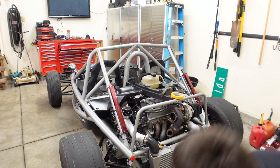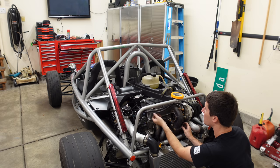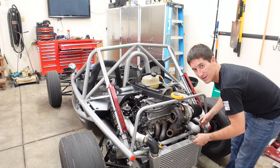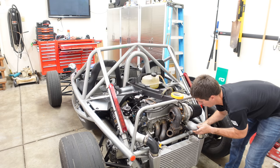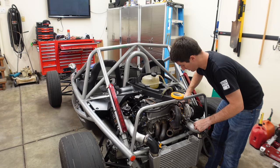I already got a bunch of this loose. There's just one bolt back there that was hard to get to. These are all 14s. Got the bolts out of the manifold flange — now the only thing holding this thing on is oil lines. Pull this gasket out so it doesn't get hurt, and this silicon coupler. She's free. I'm going to grab a bunch of zip ties and just tie this thing up. I have the rubber 2021 zip tie here — I couldn't find the zip ties, so I just grabbed what I had.